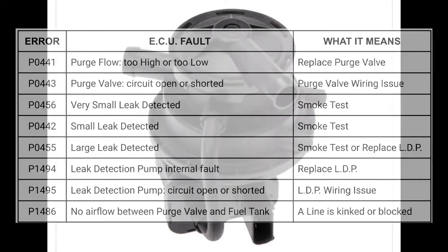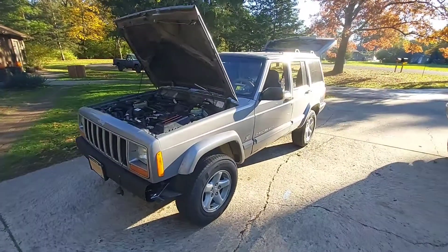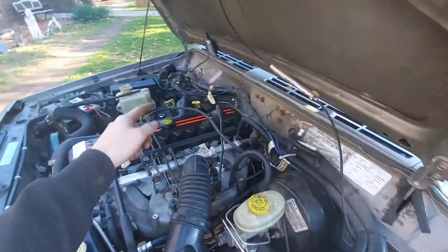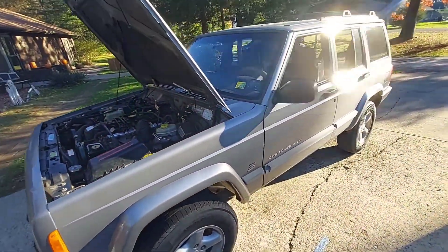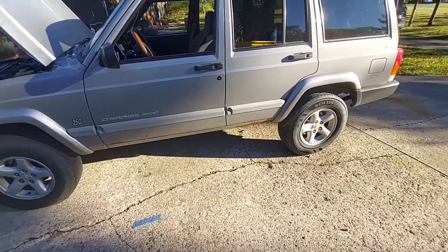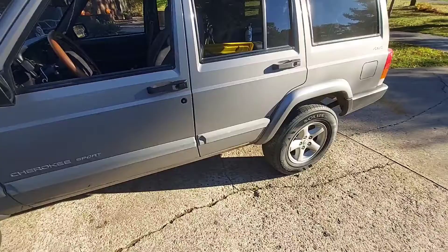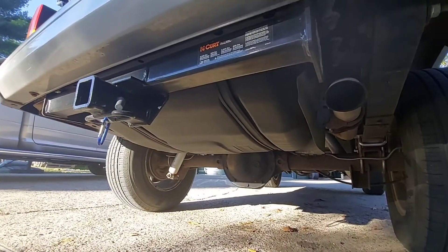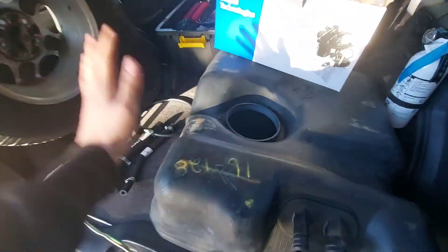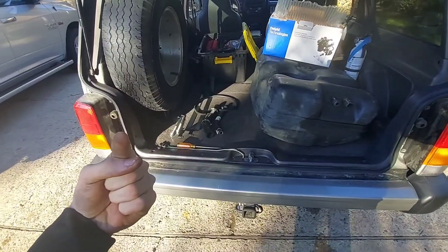That concludes the grand tour of the EVAP system. I've been looking at that check engine light ever since I've owned this thing and I'm ready to make it go away. After replacing every single EVAP fitting, the purge valve, the charcoal canister, and the tank line, my leak ended up being on top of the gas tank — which shows why you shouldn't just throw parts at it. To be fair, everything I replaced was bad, and as I replaced things I noticed gradual increases in miles per gallon. My entire EVAP system was fried from the beginning. I need to drop the gas tank, and since I'm taking it out anyway, I figure I may as well put in something better — I've got a ZJ Grand Cherokee 23-gallon tank, and in the next video I'm going to document that ZJ gas tank swap, so stay tuned.